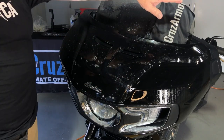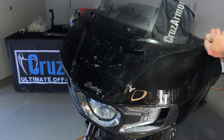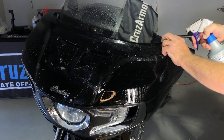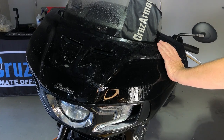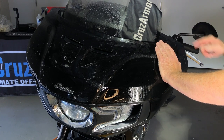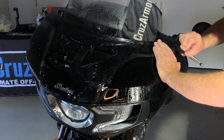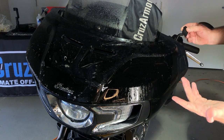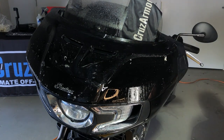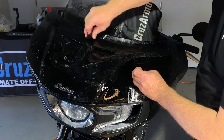We're going to go ahead and work our way out that way — same thing on this side, in reverse. Make sure it's soapy. Put a little bit of alcohol out on the tip, then slide it and pull it this way until it goes where you want it. If it sticks, lift it back up. The alcohol will make it stick instantly and not come back. Use your hand to get these big bubbles out, then spray the top with soap and work everything out.